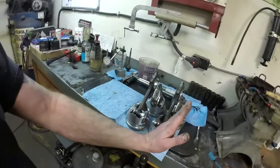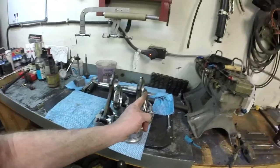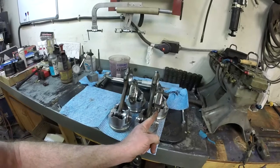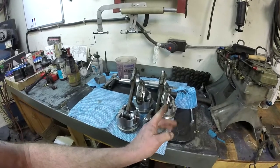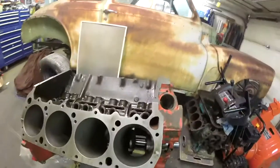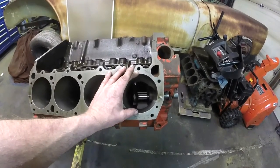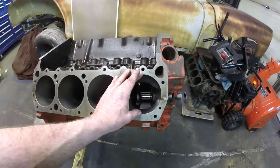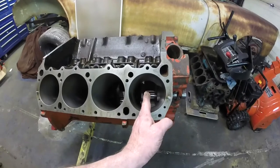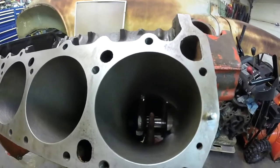When you are assembling your piston and connecting rod, there is an offset. You can't really see it on this one — but if you drew a line from the center of this bolt to this bolt, you would see that it is offset over. The reason for that is when you look down — this is cylinder number two — you can see that half the main journal on the crankshaft is centered up with this hole.